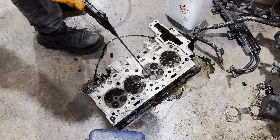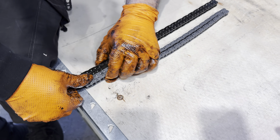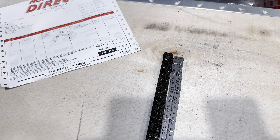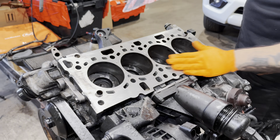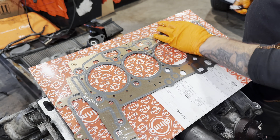Big possibility these two are bent because they completely went dry. Chain on the left looks like it's worn and ready to be replaced. The head has been done — surface cleaned as well. Fitting new head gasket.